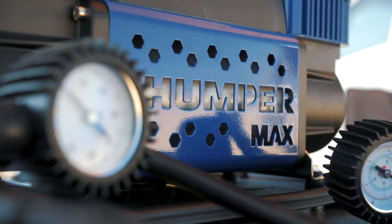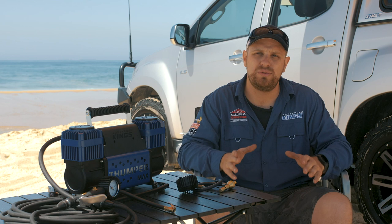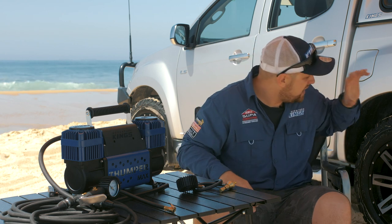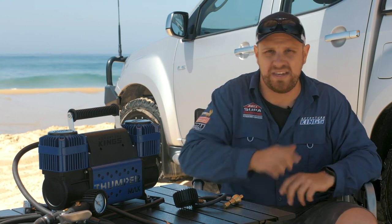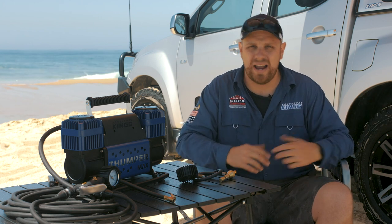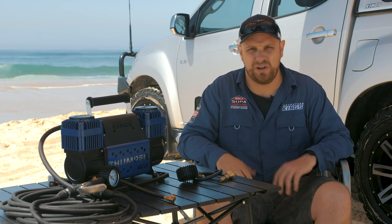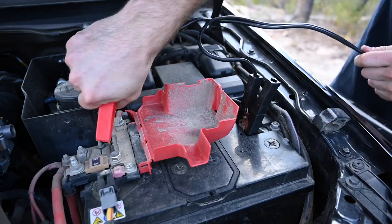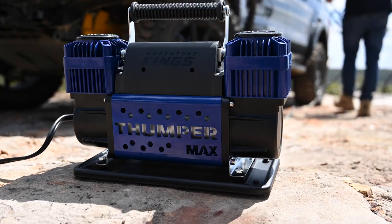The other thing I've got here is the Adventure King Thumper Max 12-volt air compressor. When you're done four-wheel driving at the end of the day, it's vital that you pump your tires back up before you hit the tarmac — because if you drive on deflated tires on the tarmac, you create an excess of heat within the tire that degrades it from the inside out and dramatically reduces the life you get out of your tires. You could go to a servo if there's one close and wait in line behind half a dozen other people on a stinking hot day for a very slow compressor — or you could just carry one of these in the back of your four-wheel drive, connect it to your car battery, and pump your tires up wherever you are. Just find a nice shady tree at the end of the day and you're set.